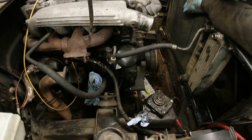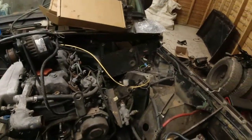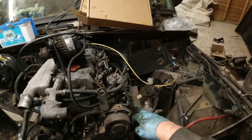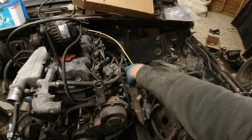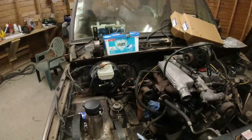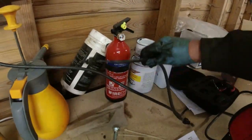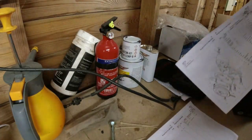The other thing was the throttle cable. So on the left-hand drive car, obviously the throttle was over there and the accelerator pump and everything is here, so it's a relatively short run for the throttle cable. It's got the mechanism which means the throttle has to go through this plug hole here, and then it's got the standard fitting onto the top of the cable. I was thinking a V8 one will do, because a V8 one travels pretty much that sort of distance — but they've got the wrong ends on them. Eventually I think I found a cable. That's why this is all the unobtainium parts.